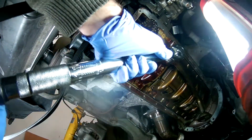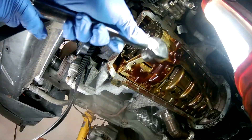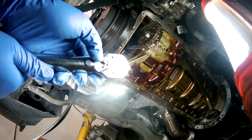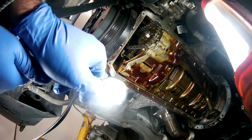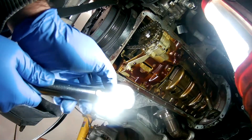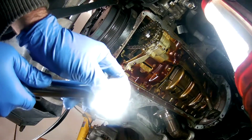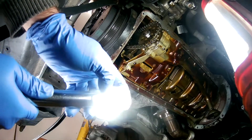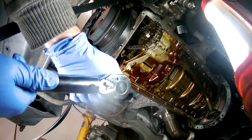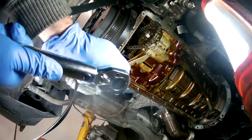We need 17 foot-pounds. Now, this is an important step to stop and talk about: if you're attacking this with a torque wrench, make sure the torque wrench is going to measure torque on either clockwise or counterclockwise settings — not all torque wrenches will measure torque on both settings. To know whether your torque wrench will work for this job, try it out on a nut somewhere else on the car at a very low torque setting on the counterclockwise setting, and you'll find whether it actually measures in the clockwise or counterclockwise direction. Just make sure your torque wrench works both ways; if you're not sure, test it out.